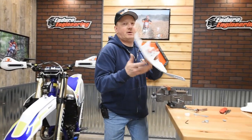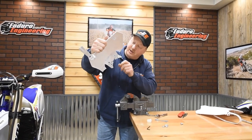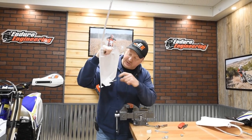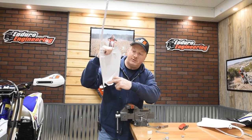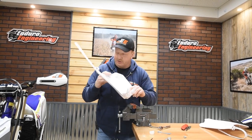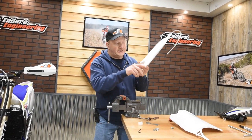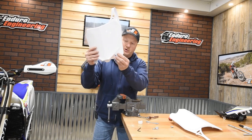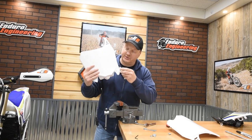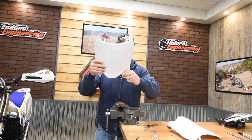We'll give you a quick look at how we modified the CRF450 number plate. It's got two sets of holes — we cut off the back ones, just leaving the front ones. Then we had to drill those out with a 3/8-inch diameter drill to open those up so they'll fit over the pegs onto the fender. We also had to drill a couple of holes here: a quarter-inch hole for the bolt, and an eighth-inch hole for the little peg that keeps the brake hose guide locked in so it doesn't pivot on you.